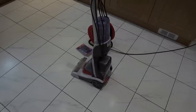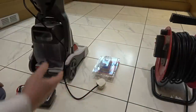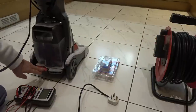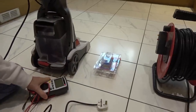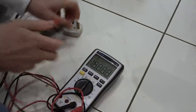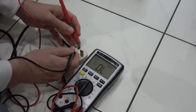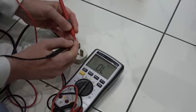Let's plug it in and see what it's doing - the coiled cable is just for testing, I don't want to unravel 50 metres to wind it back up. I don't actually know if this is on or off. What I'll do is see if we get any resistance reading on the meter when we go across the pins, because it is tripping. Between live and neutral - nothing. Let me just confirm my meter's working.